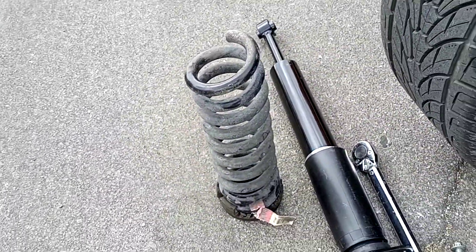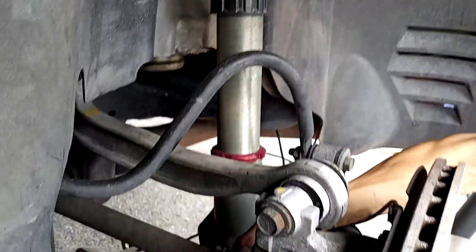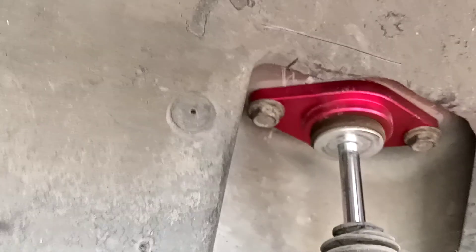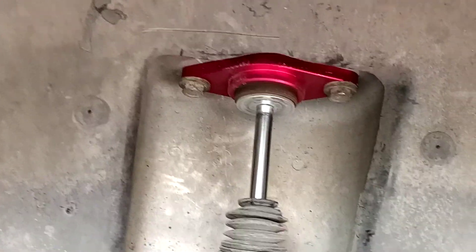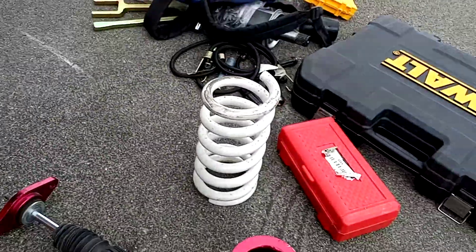Rear coil, rear spring - put the old one back in. This should be the easy part. Those bolts will be 17mm, just so you know. Just decompress the strut by itself - the shock - from this point, pull it up, and then just kind of take it out just like you did the coil, and that's it.